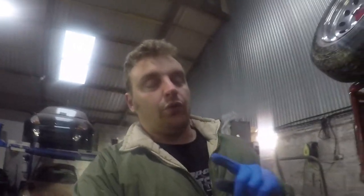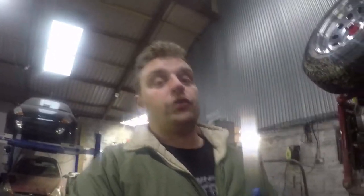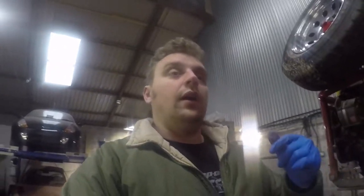This gearbox is from an Audi A4 or Volkswagen Passat — they're the same gearbox family. Originally the car would have been front-wheel drive, not transverse mounted like most front-wheel drives. This is a front-wheel drive car longitudinally mounted with a transaxle behind it — that's where the old saying about Audis with the engine all the way through the headlights comes from. Perfect for what we want to do because it's a transaxle — brilliant for mid-engine vehicles.